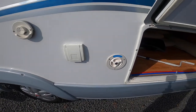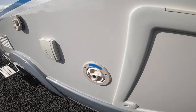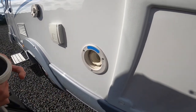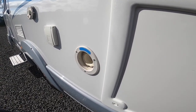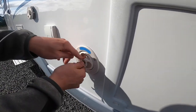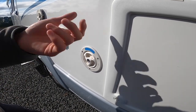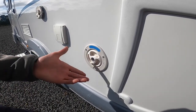So you've emptied your fresh water from the driver's side; to fill it, you fill from here on the passenger side. Using the round-headed key — this is a lockable cap. Put a hose pipe in there and wait until it either overflows outside the vehicle, or you can see on the control panel how much water is on board — it'll go in increments of fives. Take a hose pipe with you; it doesn't have to be a food-graded hose pipe as long as it's brand new and never been used in the garden. You'll also need some hose connections because it's mainly just a brass tap, so you'll need the little fitting that screws on to it.